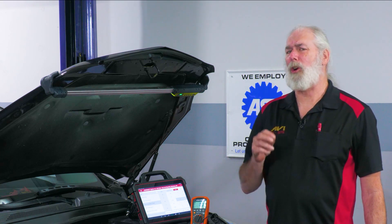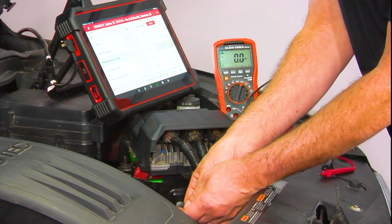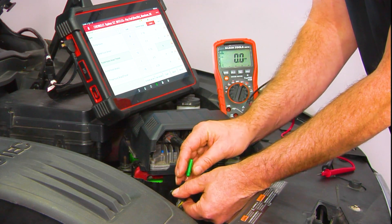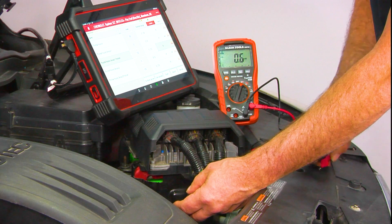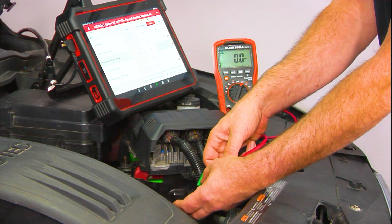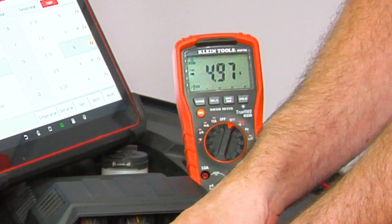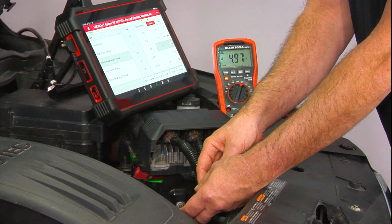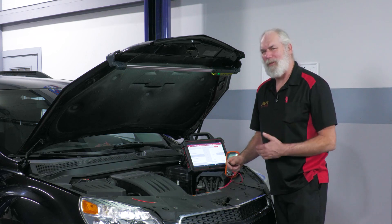So let's start with a two-wire sensor. If there are only two wires to the sensor, we're going to be looking for the power and ground. I have three wire colors here: a gray, a brown, and a light blue. The gray and the brown are the power and ground, so we'll start with them as though this were a two-wire sensor. All I would have to do is check with my meter across those two wires. I have 4.8 volts — it's a 5-volt source, so I have full voltage available to the sensor. Chances are, if I've got a problem in this case, my problem is going to be the sensor. It's a very low current circuit, so even a little bit of resistance shouldn't interrupt the signal that much. If it does, it's going to skew it — it's probably not going to cause a fault that actually turns on the check engine light.